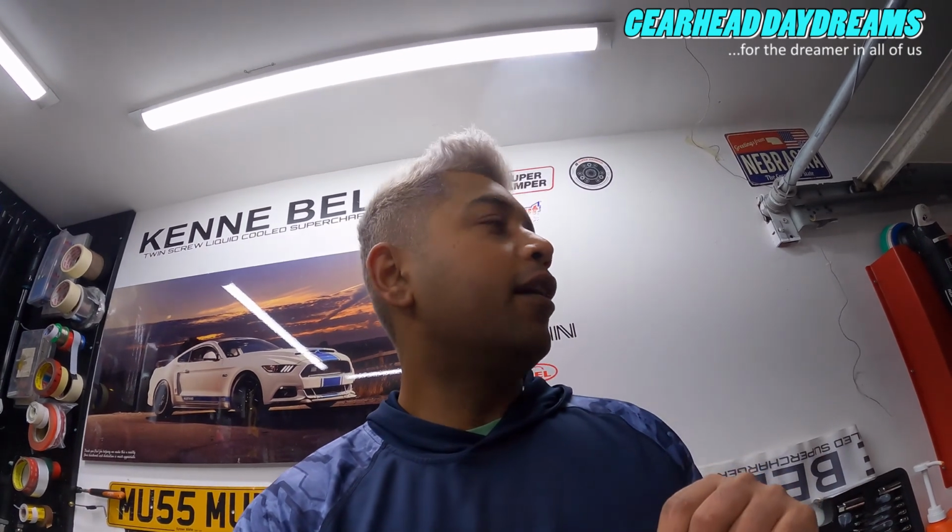But in terms of boosted, so again, supercharger, if you're going 93 pump gas, it doesn't matter whether you go for Whipple, VMP, Kenne Bell, whatever, they'll all give you about the same power. So supercharger, obviously you've got that. Then again, I would do the prop shaft. I would do the oil pump gears and the timing sprocket. I'll treat that as one mod. I would definitely consider the ATI balancer because reliability is key. And then I would do the suspension and the rear cradle bracing. So those are my top 5 mods for each one. And then obviously for the boosted one, you would have to get a tune.